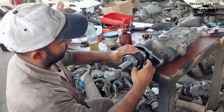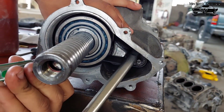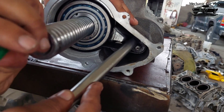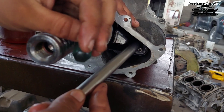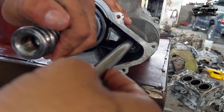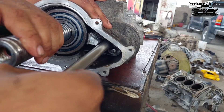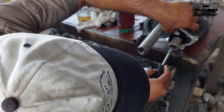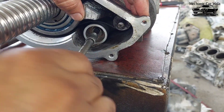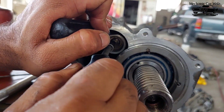Put the belt back — it could be a little difficult. Keep rotating the bearing and try to push the belt inside, because there is a rim on the pulley which prevents the belt from coming out. That's why it's a little bit difficult. This is the belt tensioner — tighten it well and adjust to keep your belt slightly tight.